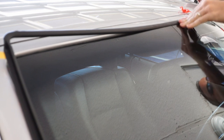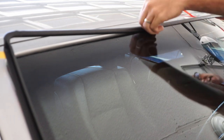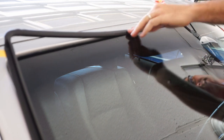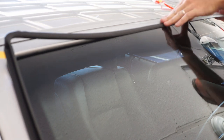I figured out the right way to do it as I went along. I'm pressing it in with the tape backing still attached, and I'm going to peel the tape out after it's already in place. I'll go around the whole thing, press this into place, get the front groove around the window, and then once that's all set, pull that tape out.